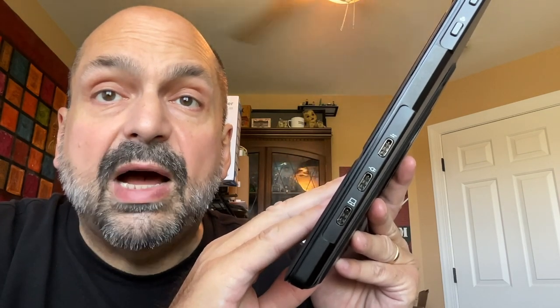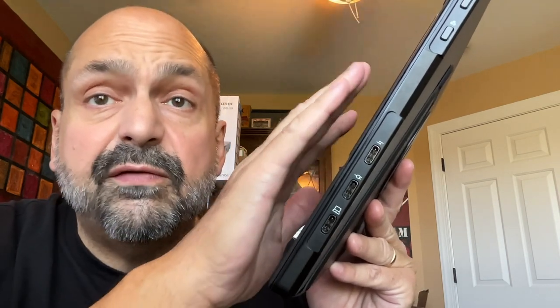Only low-power devices require that you use an external power supply for this monitor. You can use up to a 100-watt power supply. If you do, 15 watts are reserved for the monitor and to power the USB-C ports, and 85 watts can be passed on to charge your host device.